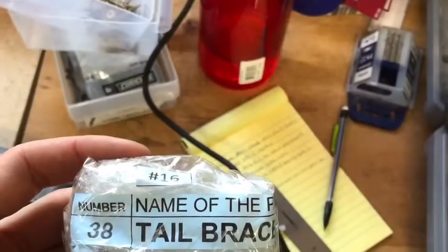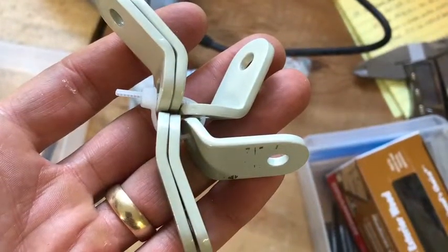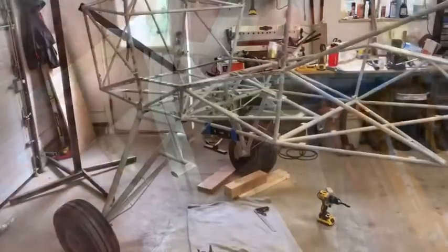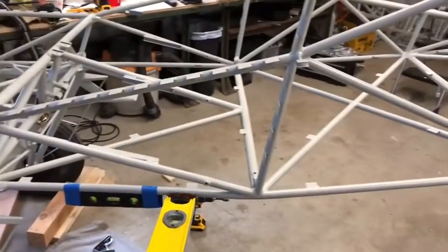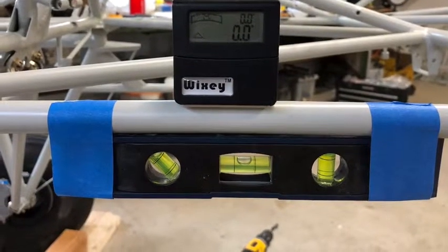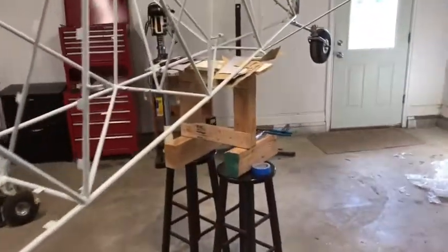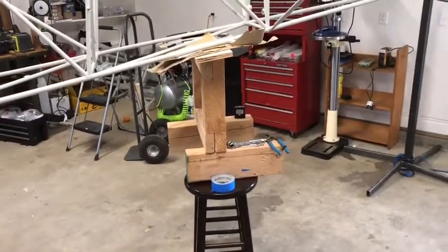The next thing I would recommend is attaching some temporary flying wires. First, you'll have to affix the brackets that look like this. You'll have to figure out which ones go where and maybe adjust them the same way you adjust the bracket for the strut. Once you get that generally attached, the first thing you need to do is start leveling everything out. Your reference for level front to back — your longitudinal level — is this tube right here, or the one on the other side. I've got a level taped in place and I worked hard to get it as exactly as possible. I've chocked my wheels because I've got the tail up and I don't want it to accidentally fall over.